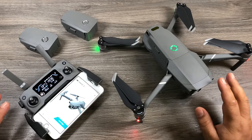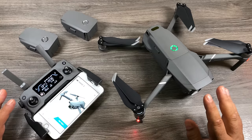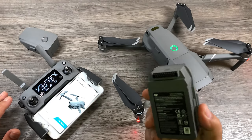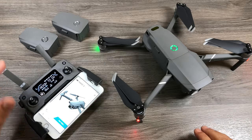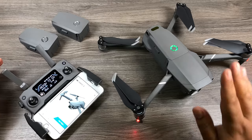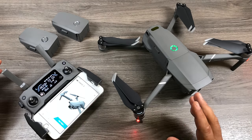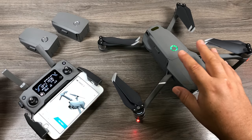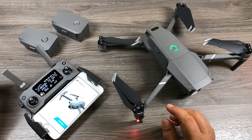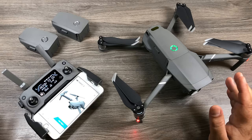We've successfully upgraded the firmware — a green bar will appear along the top of your screen confirming success. Note that the firmware update covers the drone, the remote, and the battery currently attached. These are intelligent flight batteries and they have firmware too. If you have extra batteries from the Fly More Combo, you'll need to update those as well. Power the drone off, insert a new battery, power it up, and you'll get an 'inconsistent firmware' message. Swipe the bar and it will update the battery — it only takes about a minute.